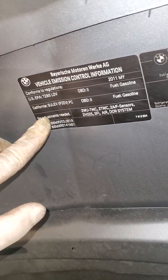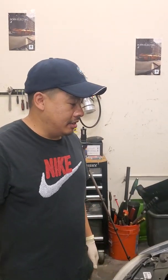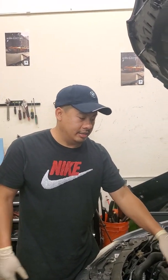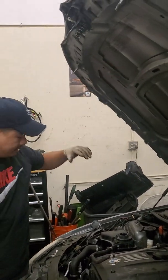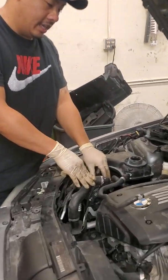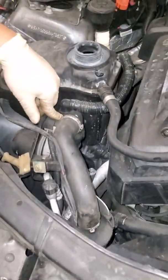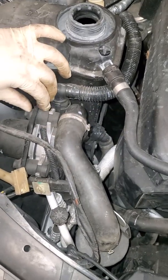If you're going to get a BMW from 2006 to 2012 around there, they all look the same. They've got the E90, E91, or E92 chassis — this is the E90. They'll have either the N51 or N52 engine. You can tell by this label, or if the label is missing, you come over here to the secondary air pump. This is another thing N51 engines have that the N52 doesn't. This secondary air pump is also expensive — around $600 to $1,000 OEM.